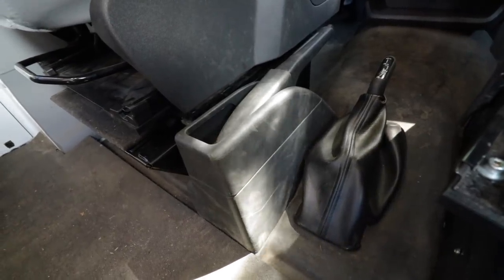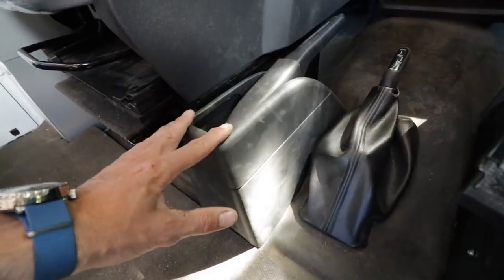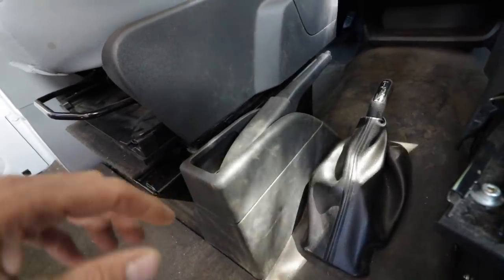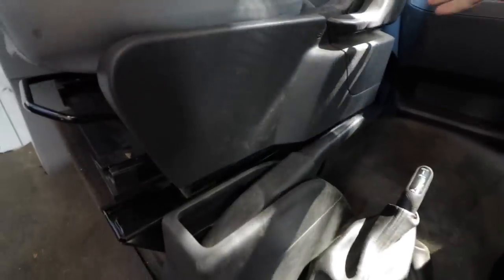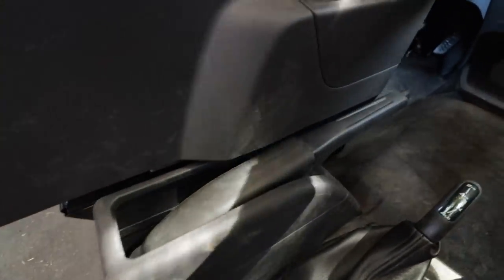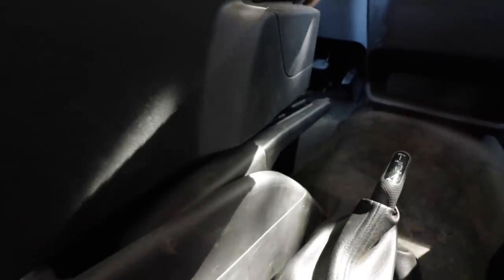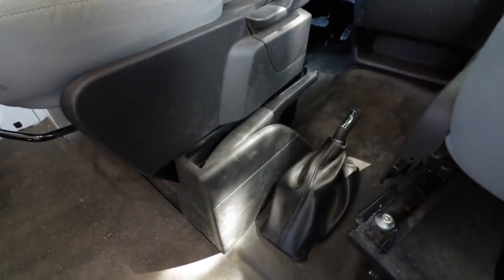There's got to be a better way. With much head scratching and figuring, I was able to lower this whole thing without messing up the function of the van and able to maintain the trims. It's the first time I've ever seen anyone do that, and I was pretty proud. The tolerance is close right there — as this swivels around here, it clears the top of that, not by very much, but enough that it won't scratch, and it has the factory trims on in their factory mounting. That's problem number one taken care of.